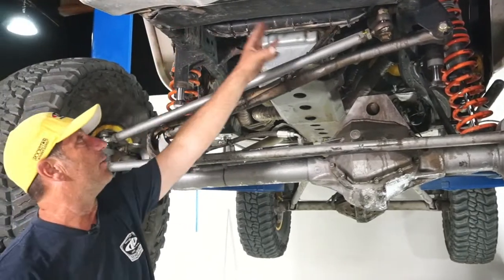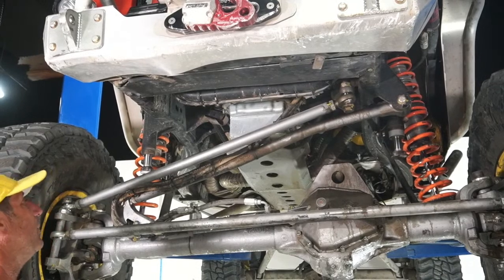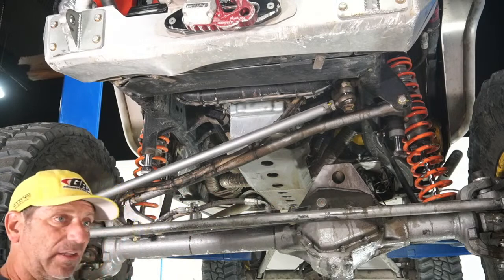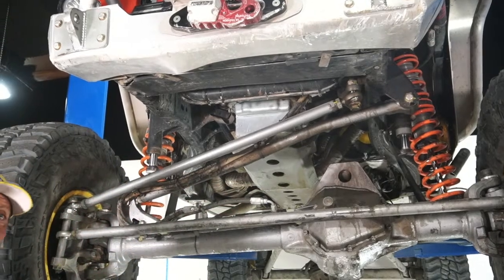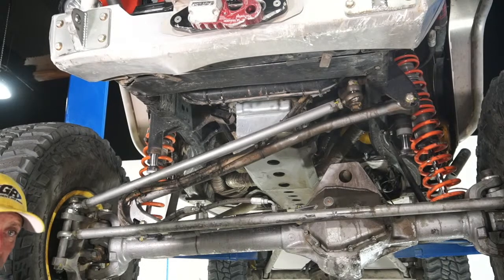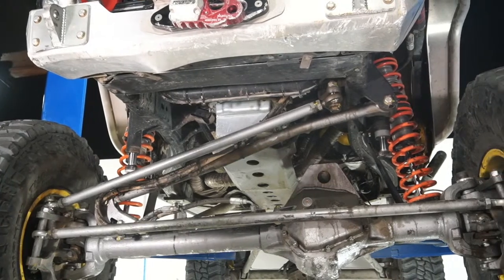The radiator is right above here — I don't see any liquid or signs it was leaking, which is good. The oil pan's a little wet, but I figured out my dipstick wasn't sealing, leaving fluid on the bottom of the frame and skid. I've got to put a new O-ring in there. When I ran high RPM it built crankcase pressure and pushed oil out. The dipstick is zip-tied down so it can't fly off, but the seal wasn't good.